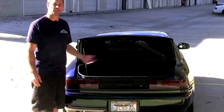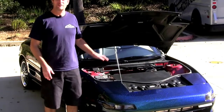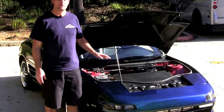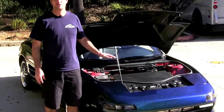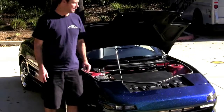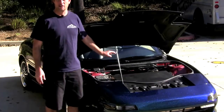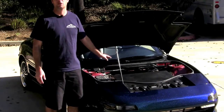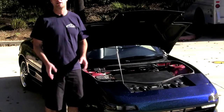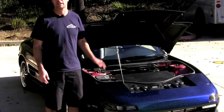Now we're going to head up to the front of the car and check out the batteries up there. So here we are at the front of the car. We went through a lot of work to actually maintain the factory look under the hood here. We've kept all of our batteries, all the high voltage cables, connectors, and fuses covered under the factory look battery box that we put in here. Behind the battery box, we have an electric vacuum pump for the brake system. The power steering is taken care of by the OEM electric system in the MR2. We also have an MESDEA RM4 heater pump, which heats the hot water for the passenger cabin for environmentals on those cold nights. So you still have a heater.